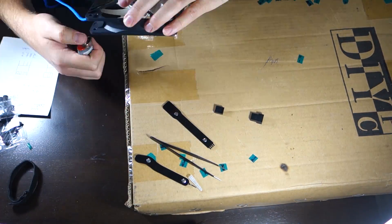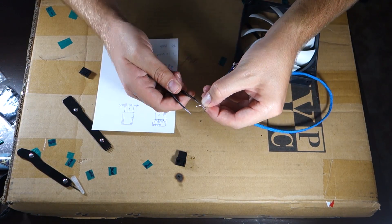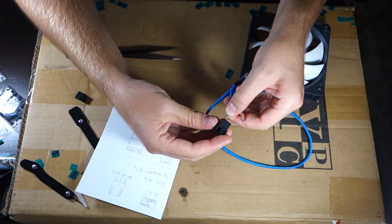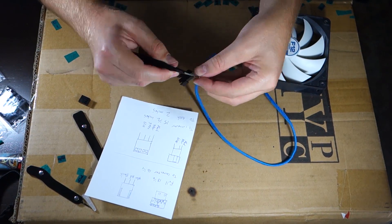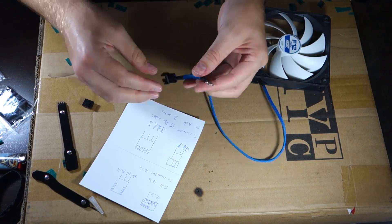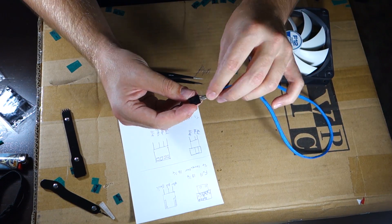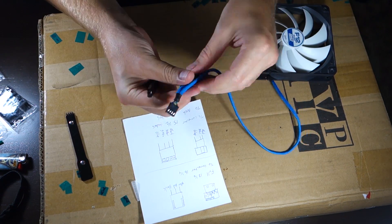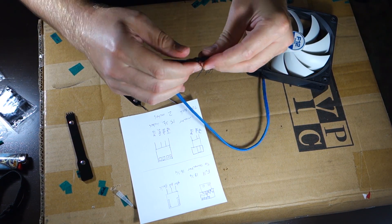With all my heat shrink settled, I've gotten my diagram back out. What I'm going to do here is make sure I pull up the pins gently — not to break them — but so that they jut out and are able to go back in their little holes and keep the wire from falling out. I use my little iFixit Tweezer set, which is great for this purpose. Then you're going to use your diagram to plug your wires back into where they should go — that should be pretty self-explanatory. If you need to refer back to the photos, there should be links in the description. When you finally get everything plugged back in according to your diagram, you're good. You've successfully sleeved what's one of the more difficult fans to sleeve, and the end result looks pretty nice — like it could have come right out of the box from the factory.